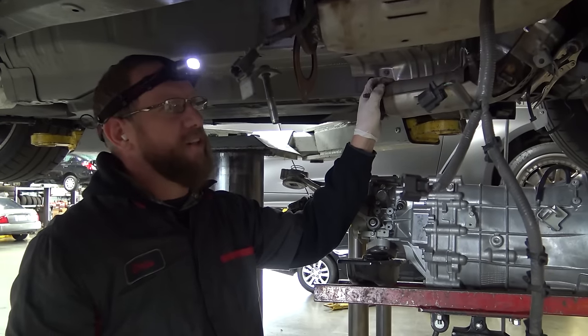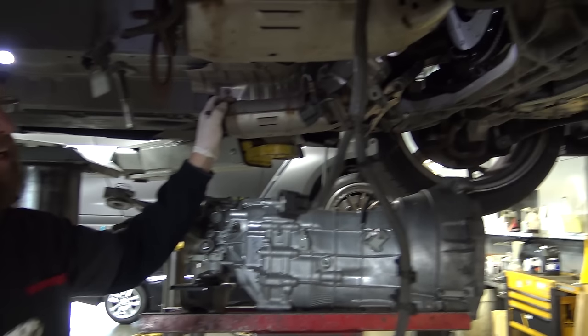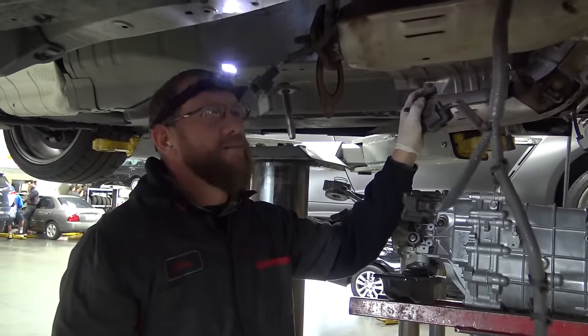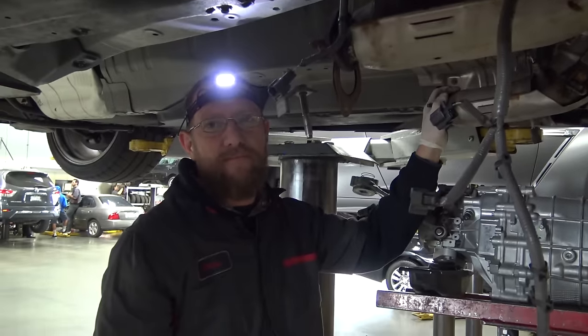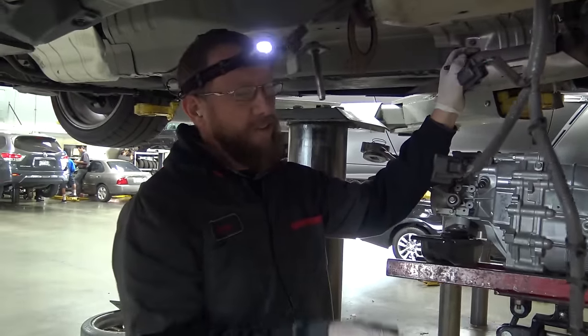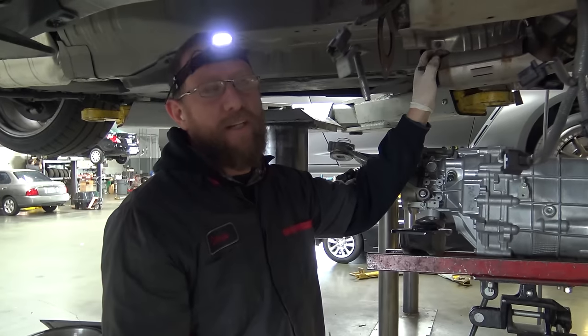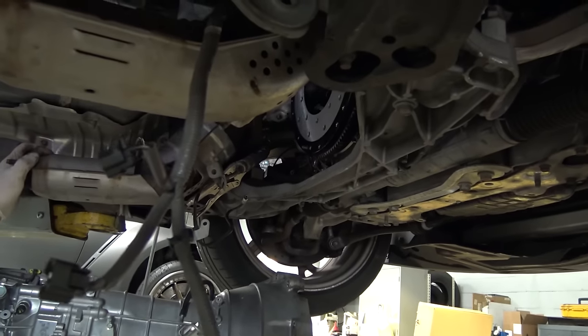OEM clutch pedal feel is going to be the same. The advantage to this flywheel is going to be that it's going to rev up faster because there's less rotating mass. It did feel like this car revved pretty slow. When in neutral, if I revved it, I don't know if maybe the electronic throttle just wasn't responding as fast because it's in neutral, but it felt kind of slow. The difference in flywheel weight is probably about 10 to 15 pounds. Right, and that's a lot of unsprung weight there to be turning. Correct. Alright, so that'll hopefully get some revs up quicker there.